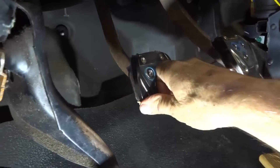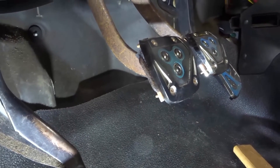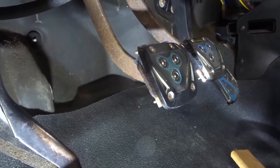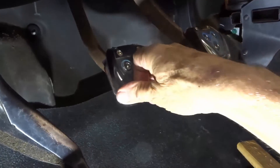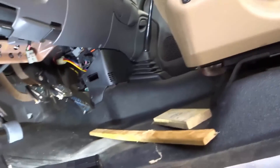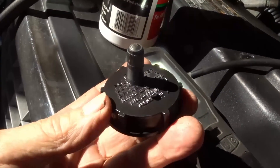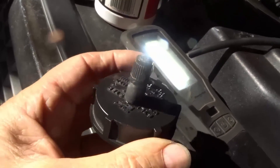This is a demonstration of the proper clutch pedal travel — notice it starts all the way at the top with pressure. After a few days this went down a little bit and I had to go back and burp it again. That is the process that works for me — I hope it works for you too. Now just remove the screw plug in the vent hole and place a valve cap on the valve stem and everything is back to normal.